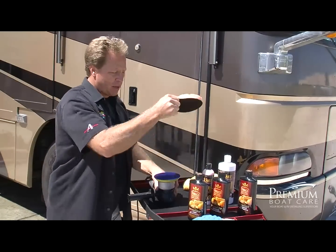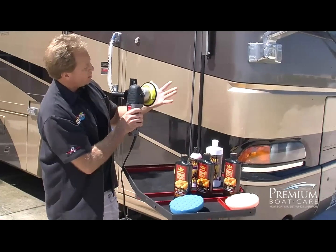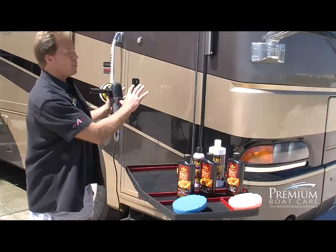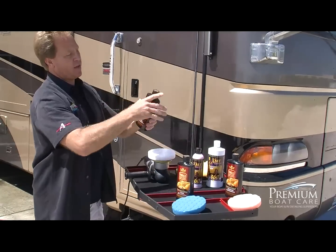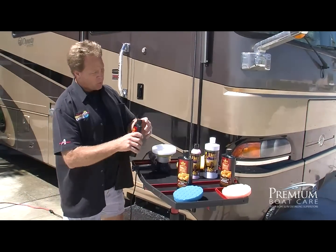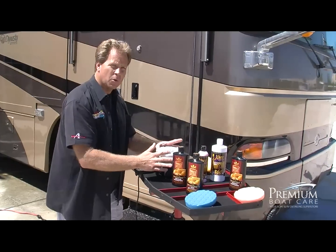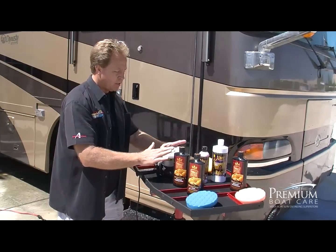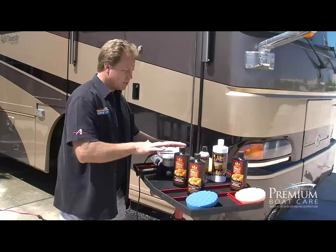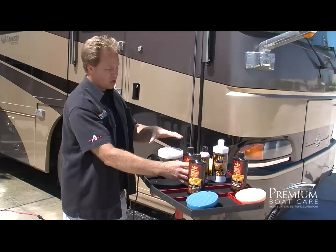When you're ready to move on to the polishing step, take your foam cutting pad off and switch over to a softer polishing pad. Center it up on the backing plate. I'm going to bump the speed down to the five setting — I don't need all that power because I'm not trying to remove swirls anymore; now I'm trying to polish this to a really high gloss. For this, we're going to use the Pinnacle Advanced Finishing Polish. Shake the bottle, apply some product right onto the pad, and push it around with your finger — priming the pad ensures 100% of the pad works for you polishing the paint. After the first priming, you just add about three pea-sized drops onto the face of the pad each subsequent section.